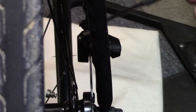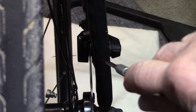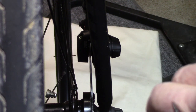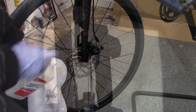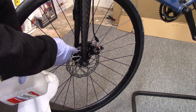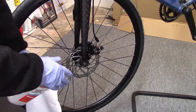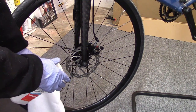This was not an issue with the caliper being off-center. We can see a space on either side of the rotor, so something else is going on. I really don't see any grease or dirt on the rotor, but there must be some dust or something else accumulated as I was riding across that rails to trail.